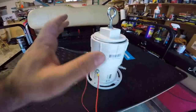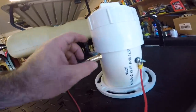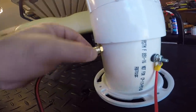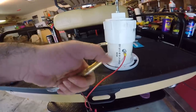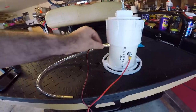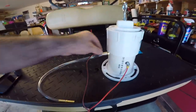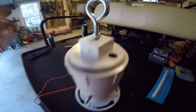Never clamp your hoses on these — that's just my recommendation. Never clamp the hoses, because at least it could blow the hose off. If you plug this into the car and for some reason pressure starts backing up, this needs to come off — pressure has got to come out of this thing without blowing it apart. It can either push the hose off, or if it gets bad enough it can just pop this plug out of the top and relieve some air.